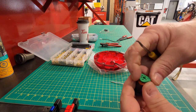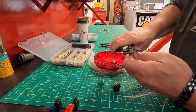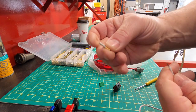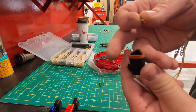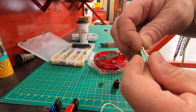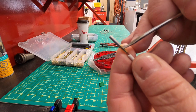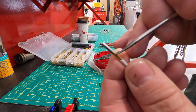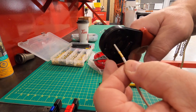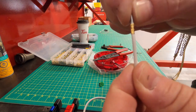To get this off, you just pop that out. To put them together, you just peel off a little bit of the outer insulation about that much. Put one of these sockets on here because this is a male end — you use the sockets. Put it on just like that, and there's a little hole right there. If you can see wire in there, then the wire is pushed far enough inside that you can crimp it. These are the little crimpers for the Deutsch connectors — just push it in there, pull it down, squeeze it all the way. And it's a good, sturdy connection.